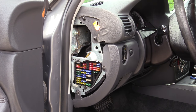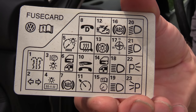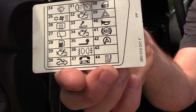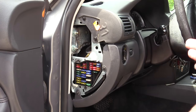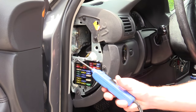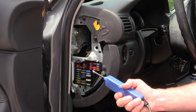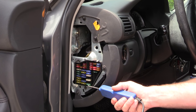The wonderful thing about my Passat is that it actually has the card that tells you what fuses go where. It tells us this symbol is for turn signals, and if we flip it over, it shows us the location for the hazard switch fuse. We're going to check both of those fuses. As I always recommend when you're checking fuses, don't just check the two it says — go ahead and check them all really quick. It's ultra fast, especially on fuses where you can check both terminals.